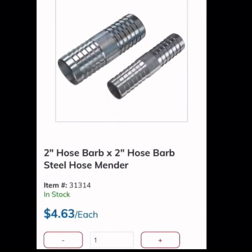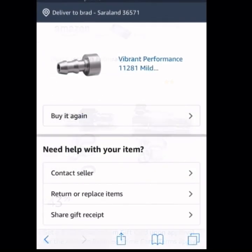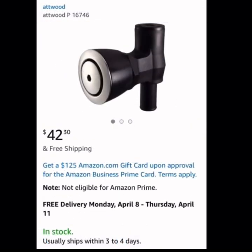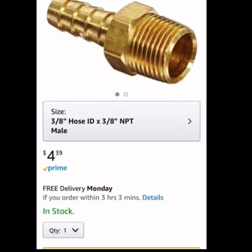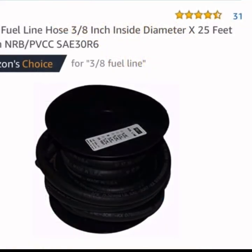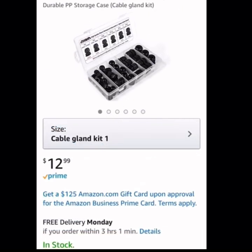I'm showing you most of my parts — I got most of it from Amazon. Definitely don't go on the cheap route. When it comes to your quick connects, you need to have the best fuel system quick connects — they don't leak when you unplug them. I probably spent about $300, maybe $400 on this fuel system. When you select your fuel line, just get good fuel lines — 3/8-inch diameter. Don't skimp on your worm gear hose fittings; you definitely don't want to go cheap on that.